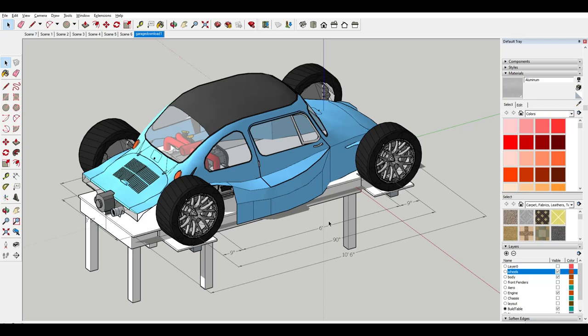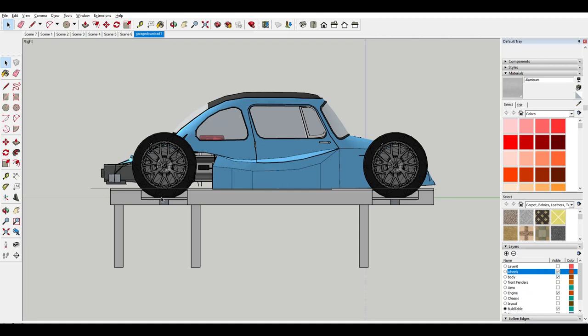Every good build starts with a good foundation. For builds like this, it can be as simple as building the chassis on the floor of your garage, or as complicated as purchasing an industrial fixturing table. For my build, I'm going to be building an elevated platform out of 3/4 inch MDF, 2x6s and 2x4s. Some key features of this table is the fact that the four wheels will be supported on removable platforms at ride height relative to the chassis. This will enable me to fixture every component, including the wheel hubs, so that the suspension can be designed in place.